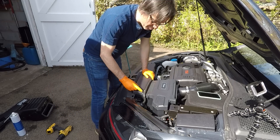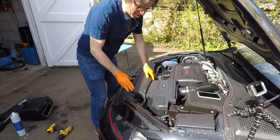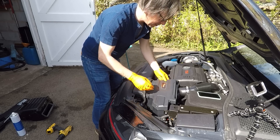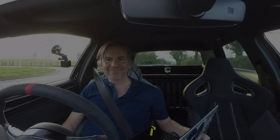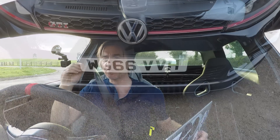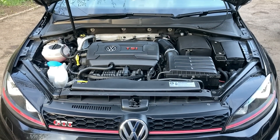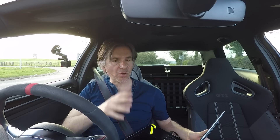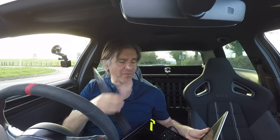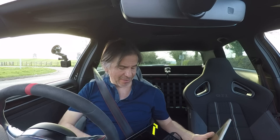You can get a coolant under-hose from RacingLine that routes this underneath for a tidier look, but I'm not really that bothered — I like to keep the coolant hoses original. Now it's time to drive the Mark 7 Golf GTI Club Sport S. I've put the standard airbox back in so we can see what it sounds like stock. We're also going to log some data — I want to see if we can get more air into the engine with the R600, so I've got VCDS running in the background logging that data.